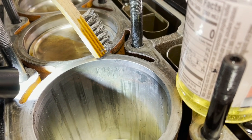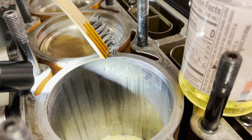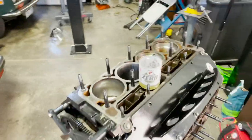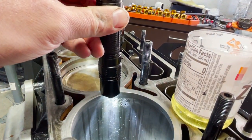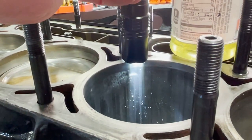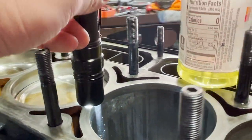That's kind of what I'm talking about — if you guys can see right there, there's that little divot. You can see the shadow in the cylinder wall. Hopefully that's just from the stuff around it, but if that actually goes into the cylinder wall, then that might show that it needs to be sleeved. Well guys, we got it pretty much 99% cleaned up — but we have some bad news. So Alex wants to do the honors with the light. That is actually into the cylinder wall — it's pitted into the cylinder wall right there.